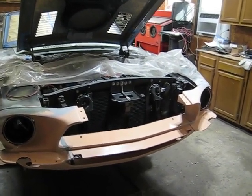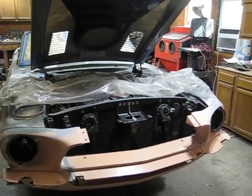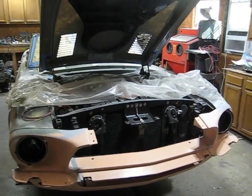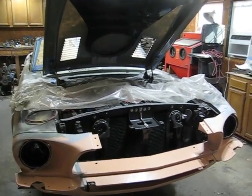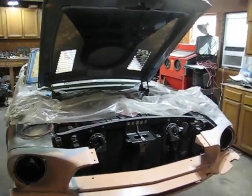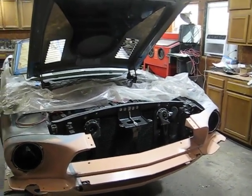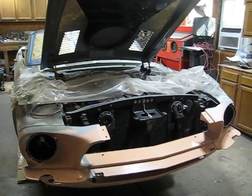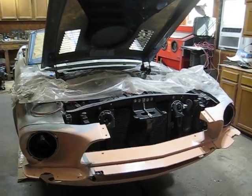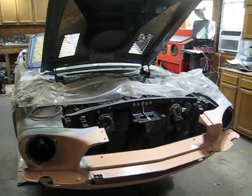It was overfilled, and there's a vent inside on the case of the transmission, and the transmission fluid was just leaking out the vent because it was overfull. So I took about 2.5 quarts out, and it's still overfull. I need to take about another quart out of it, and I think the drip is basically gone. So the transmission leak has been resolved. I didn't think that putting a brand new seal in and not even running it was going to have an effect on it. So I got that resolved.